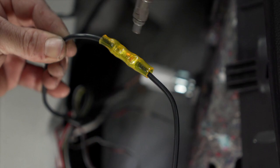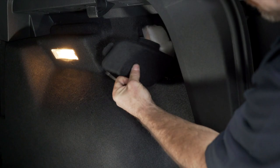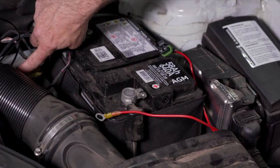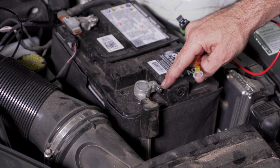Follow the wire harness from the tail light and cut away some of the protective tape to expose the different wires and figure out what is what. On the passenger side we will be able to use this punch out to access the wires, as we don't need to route the power wire out of the vehicle, but we do need to remove some of the trim. Now that we're ready to begin testing some wires, we will stick the fuse in. Secure with zip ties to a hard brake line and hide your power wire behind the battery before affixing it to the vehicle. This style nut does not want to fully come off for safety, and with the ring terminal not fitting we need to make a small cut so we can get it behind the nut.